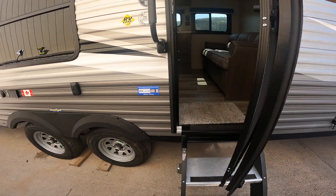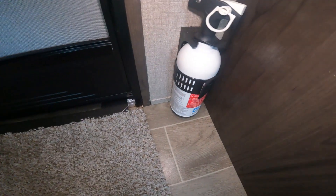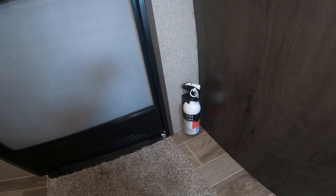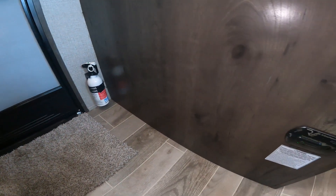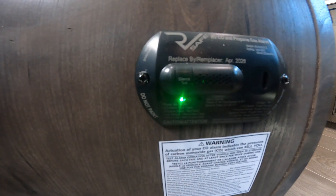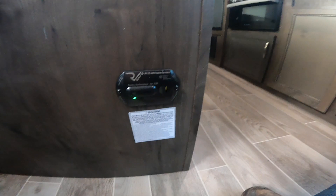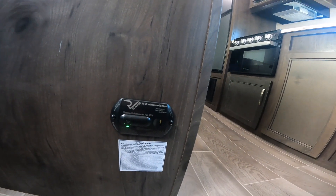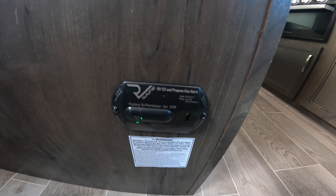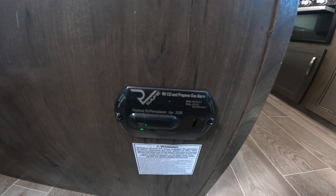Now that we've covered the outside, let's move inside. After we step inside, we'll turn right around and look down at the fire extinguisher. I always like the placement right inside the door — it makes it readily accessible inside if you need it while cooking, or outside as well. Just to our right you'll notice we have a propane and carbon monoxide detector. At the moment there's a solid green light, indicating the system is working properly. There's a button here that we can press to test the system. I recommend pressing and testing it every six months during daylight saving time, at the same time that you change the batteries in your smoke detector. When you press the button, you'll hear a series of loud beeps and the light will change from green to red. Once done, it'll stop making noise and the green light will return, indicating the system is functioning fully and properly.